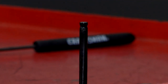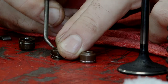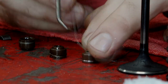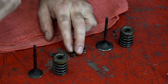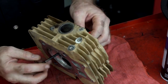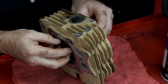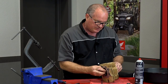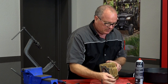Next let's go ahead and get our seals popped off. Won't take much effort — don't push too hard because I don't want to damage the valve guide. We're going to compare them to the new ones. The old one, the top is just a little bit stiff, almost crunchy feeling. The new one, nice and pliable — really a kind of an elastic feel to it, it pushes back against you. Now while we've got the seals out, I want to take a look at the valves one more time, just by feel — running it in there seeing if it will rock back and forth. This is telling me if my valve guides are worn out. It's got a little bit of play in it but not much, so I feel very confident that going with new valves we're gonna be good to go.